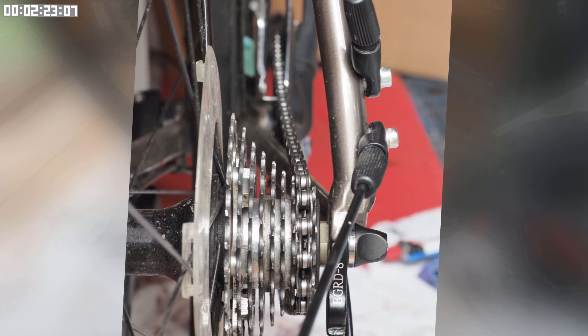If you're a bit more unlucky, the hub axle will bend. And if you're really unlucky, and particularly if you're riding a very lightweight frame, the chain stay will be compressed to such an extent that it will break. It'll crush just like you can crush a Coke can fairly easily. Luckily, I haven't experienced this myself, but I have seen a chain stay that has been crushed like this. Of course, the frame is then ruined.